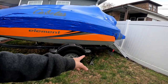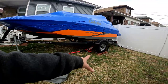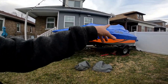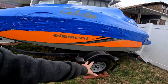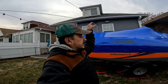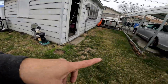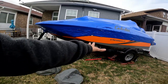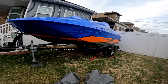I haven't had time to get out here, but I got the jack stands and two 3-ton jacks underneath this. So that boat's not even on the ground right now. That's on the 3-ton jacks lifted up already. But I do that so those tires don't go flat sitting on the ground. And then I put the tire covers over it, because when sun hits this all day long, sun's going to dry rot this tire. This tire will deteriorate before the tire on the other side, because the tire on the other side is not getting any sun like this tire. But if they were sitting in the dirt, they would have dry rotted already. That's why I leave them on there. So now both of them are lifted up evenly. And then little by little, I'm going to lift them up to get the jack stands on a brick underneath it. And then I'm going to lower it down.